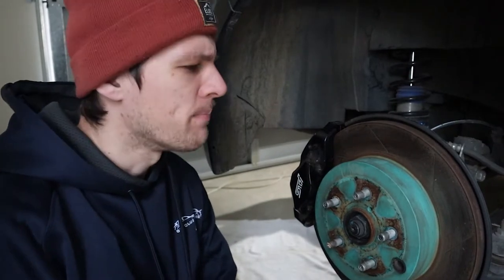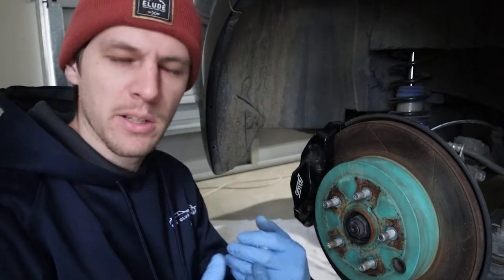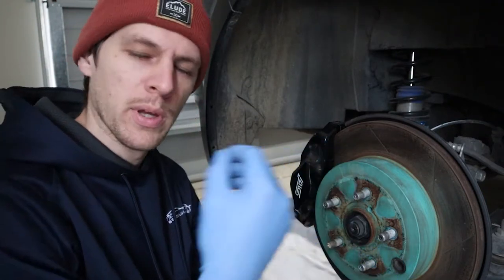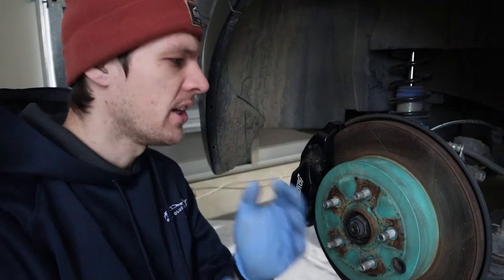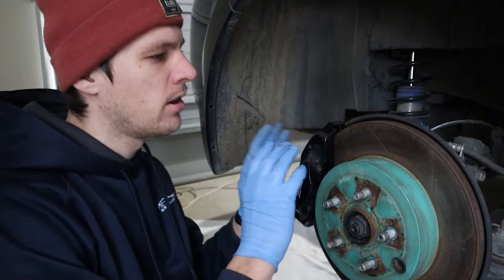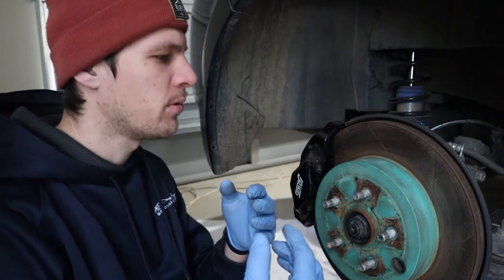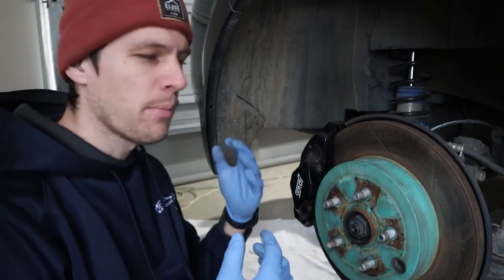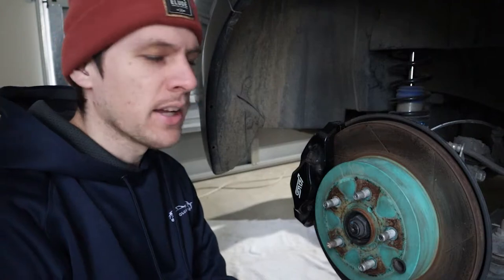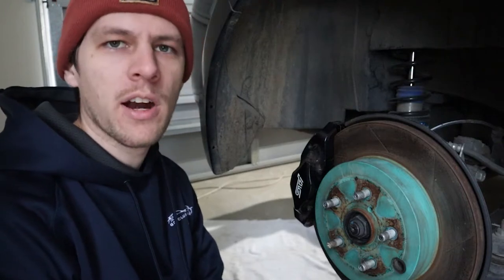So what I've discovered while trying to do it the first way is that once I had the pistons out of the way and tried to put one of the brake pads in, put the pin through, and then put the other through, it was really hard to do. What I'm actually going to do is sit the caliper in its position over the rotor, put the brake pad in, and then put the other one in. I think that's probably going to be the easiest way, and it seems to be what a lot of people do.